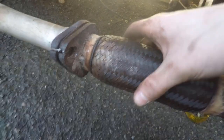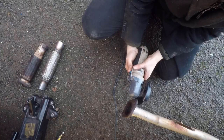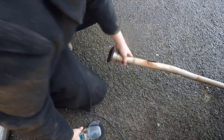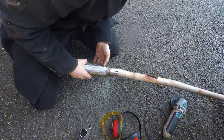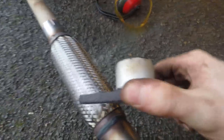So that is the original, and on that side it goes over like a sleeve. The down pipe goes into this and stops — the furthest it can go in is there, which means it's slightly shorter. This section of flexi-pipe is longer and goes past the flange, so what I need to do is cut the flange off where it gets smaller so that it will fit on. Make sure when you cut it, you cut it as close to where it widens out as possible — that way you get as much engagement of the pieces.